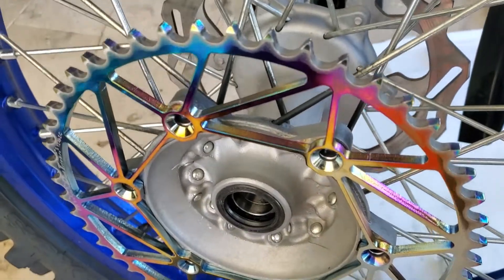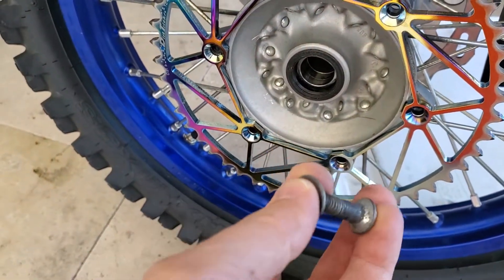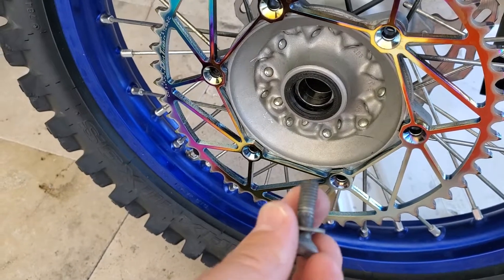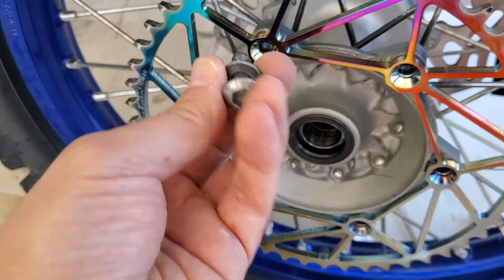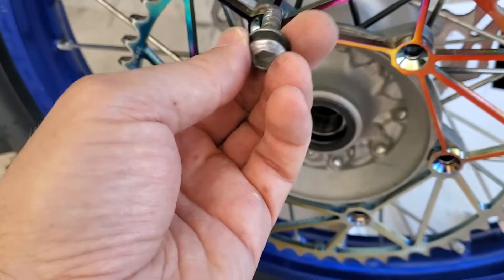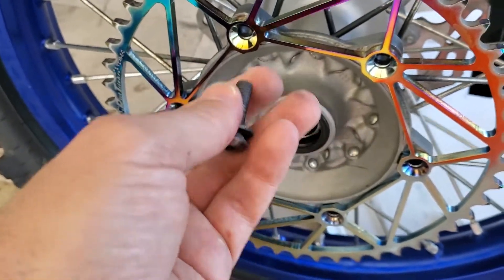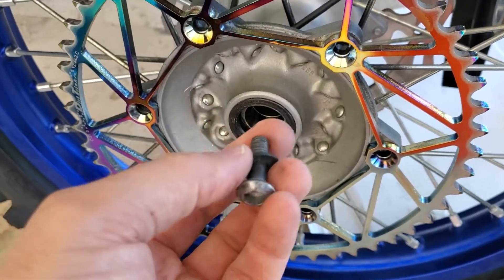Like any spring, once you've over-stretched it, it doesn't spring back. So reusing these bolts may have made them a little tired. Maybe I over-tightened them — we all want to get it on there nice and tight. I also think it's possible that the hardness of this steel didn't allow the bolts to set into it properly. Similar hardness steels or aluminum and steel would kind of bite into each other, but this sprocket is so hard nothing is going to bite into it.